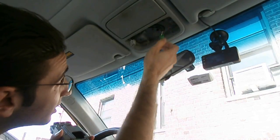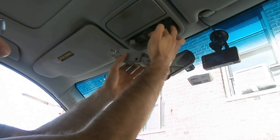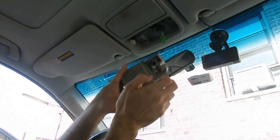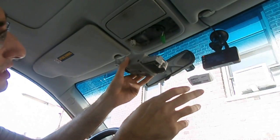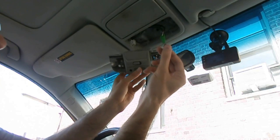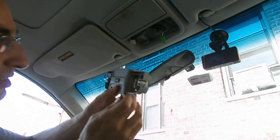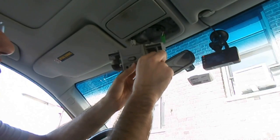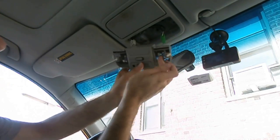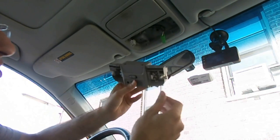An important thing to note: you can't test it hanging in the air unless you bridge the connection between the chassis or roof of the car and where the bolt goes - that's the ground. The bolt is actually part of the ground. The right machine screw definitely closes the circuit because it has a metal connection going there. Sometimes when your lights are flickering, it's because the ground isn't secure. To complete the circuit, this has to make contact with the roof of the car - the whole chassis is the negative ground terminal.